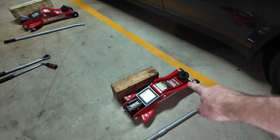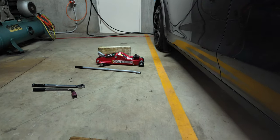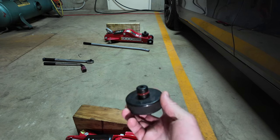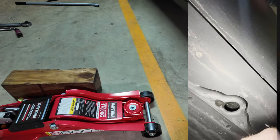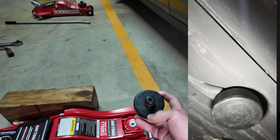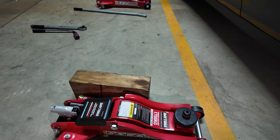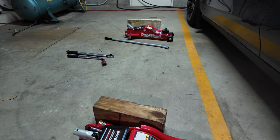I've got some hydraulic trolley jacks here with 1,700 kilogram capacity each — more than enough just to lift up a corner of this car. I have these little Tesla lifting adapter jacks — a small knob on the end locates into a slot in the car at the safe lifting point. That's the only point you should lift the car from, otherwise you risk damaging the battery. You can't just put the jack anywhere underneath here. I've also got some timber blocks to stick under the car as a safety measure — you should never rely on the jacks alone.